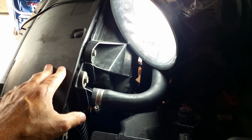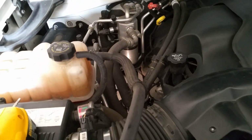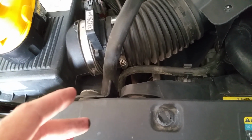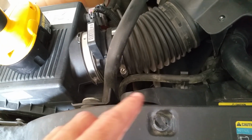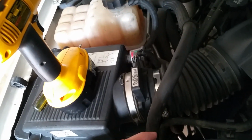Once upon a time, about 5 years ago, my wife came home, and out of the top of my radiator, actually on the ground, there was what looked like strawberry milkshake. On this side, just like on the other side where the oil cooler lines are, there are little smaller diameter lines that come from the transmission. Here's one of them. The barrier between the transmission fluid and the radiator fluid was breached somehow in the radiator, so coolant was spitting out of here, mixing with it, and coming out looking like strawberry milkshake.